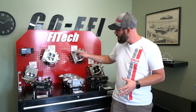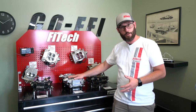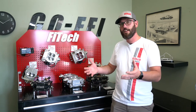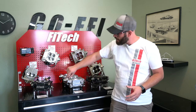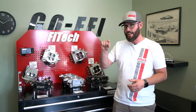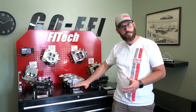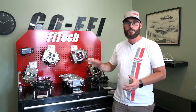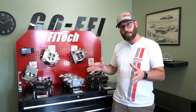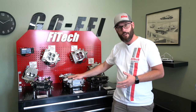With all the EFI systems, there are some key points to remember. Number one, they're a universal product — any four-barrel intake they should bolt down to. Sometimes if you've got a spread bore intake, there can be a little bit of a vacuum leak, but there are adapter plates out there — really thin stamped steel, 3/16-inch thick — that can be put underneath. That doesn't raise the throttle body a lot, so it'll fit under the hood of most vehicles. Sometimes you've got to fix vacuum leak issues and make sure the throttle bodies seal properly.